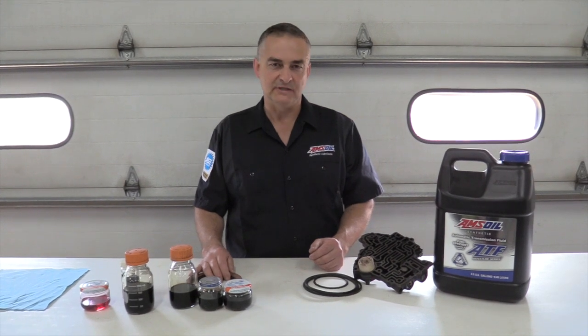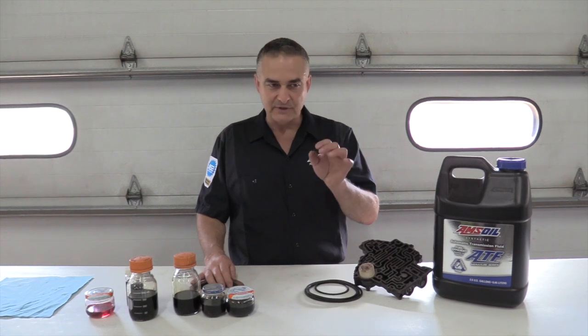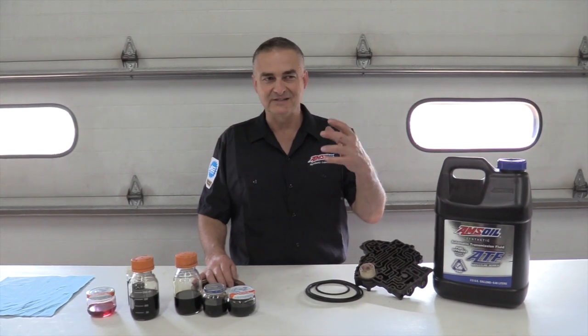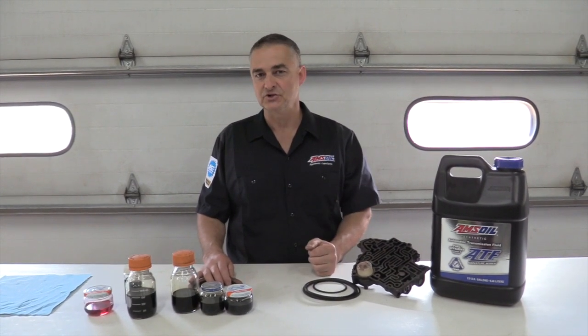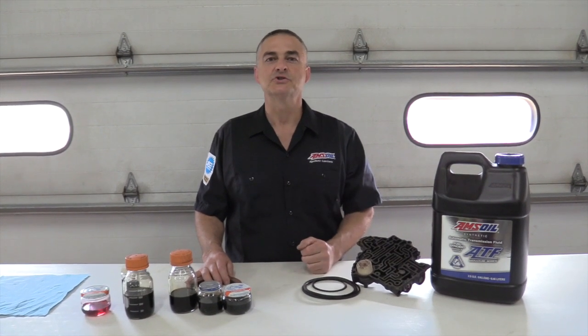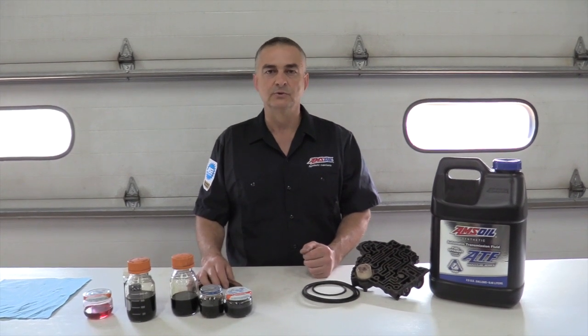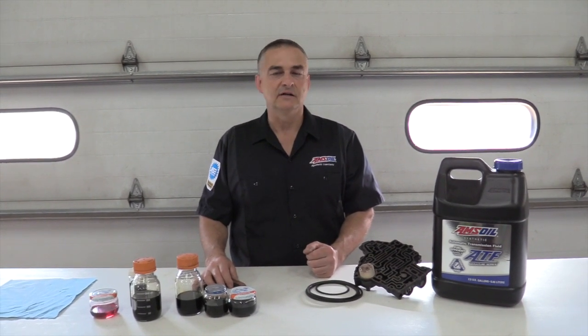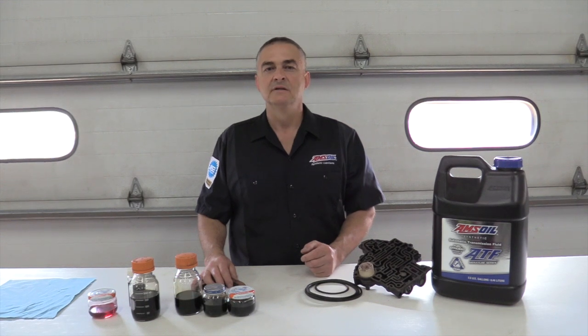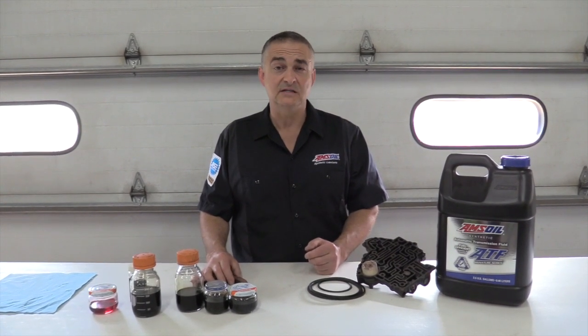In the transmission, when you go to flush it, most of the time, most people are going to take it to either a dealership or like Jiffy Lube or someplace like that to have it flushed. What they have is a machine. It's probably a $3,000 to $5,000 machine that they'll hook up, and they'll do a back flush on your transmission through the cooler lines, and they never get the transmission pan off. And when you do a transmission flush that way, you're asking for trouble.